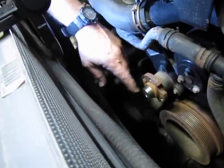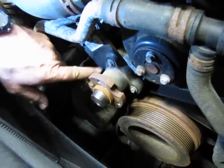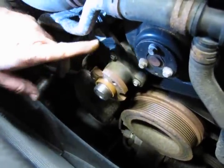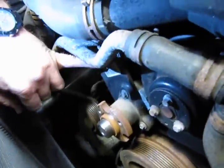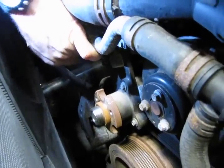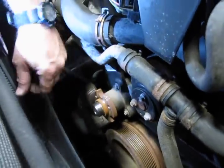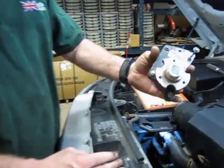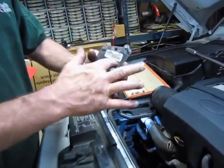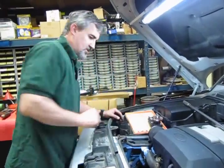Before you can remove the belt, the belt rides in behind the mounting bracket for the idler hub for the outer drive belt. You'll have three bolts here which you can access with a short extension — they even put cutouts in the hub so you can access the bolts — and then another bolt here and one just below it. Take the lower bolt out first because it also holds the bracket for the cooling pipe, which you'll need to move up and out of the way when removing the upper bolt. We've removed the bracket — you have two top bolts, a short bolt holding the hose, and the three bolts behind the hub. Set this aside; the air filter box makes a nice parts tray.